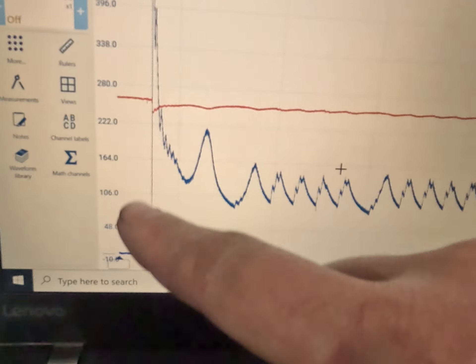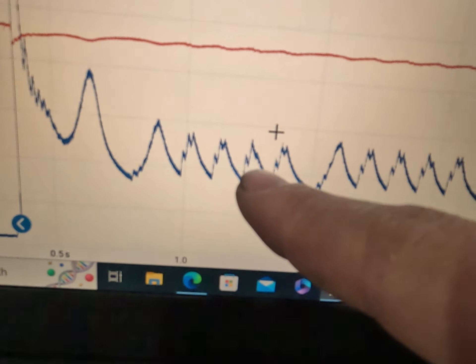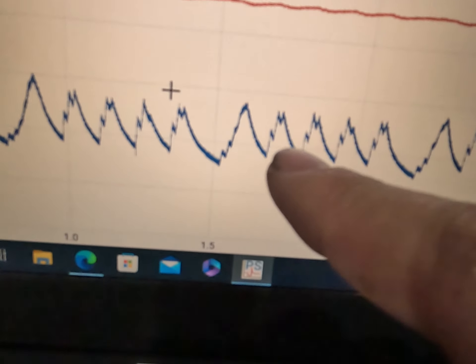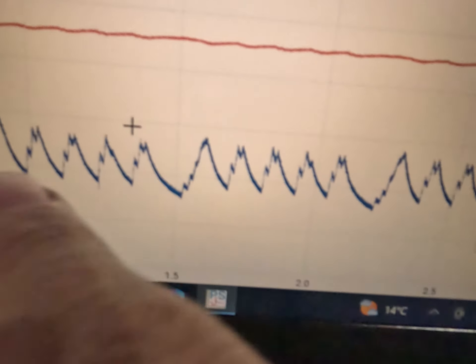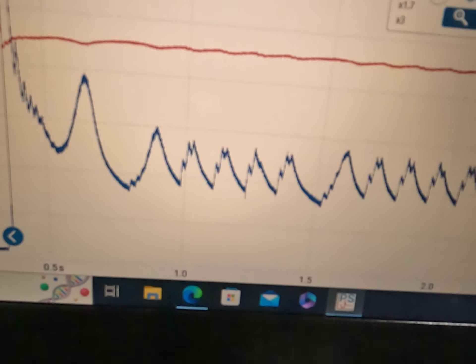As you can see, this is a six cylinder vehicle and we are completely dead on one cylinder. Zoomed in here is our initial inrush current, and we've got one, two, three, four, five — dead cylinder. One, two, three, four, five — dead cylinder. So we have completely no compression on one cylinder.